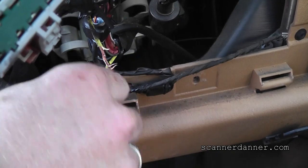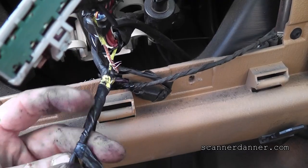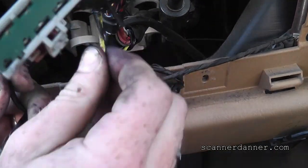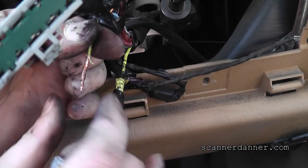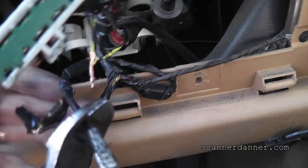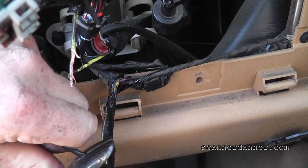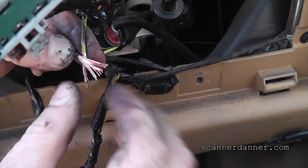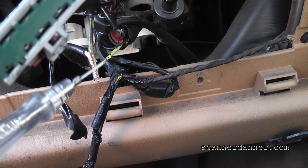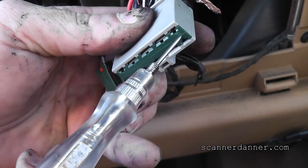I attached the wrong yellow wire — this one here is from the ignition switch up here, and then load side turns to black. They had a different yellow wire so I attached the wrong one — that's why that didn't work. Here's the half I need. Let me strip this back. I'm just reconnecting it temporarily — stuff's coming out anyway. Here's the one where yellow turns into black. I need that one off. Let me strip this back. From here, you hear the starter cranking. And then from up here — the original testing location — sweet.